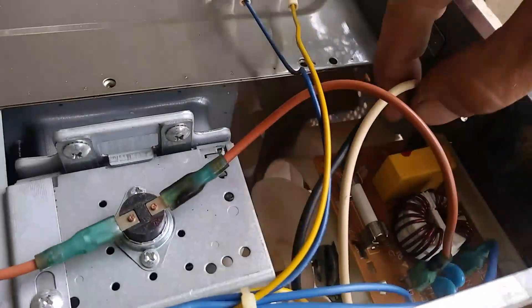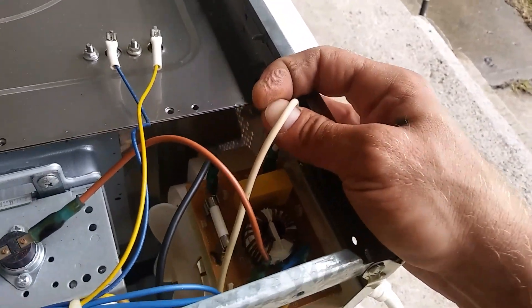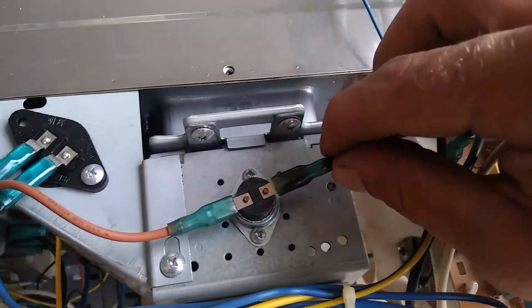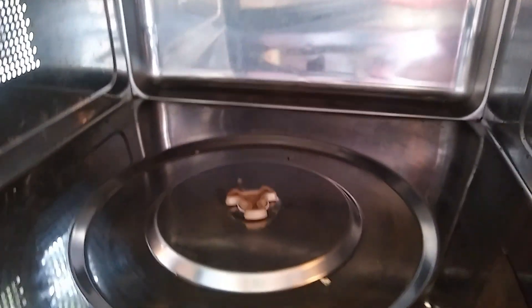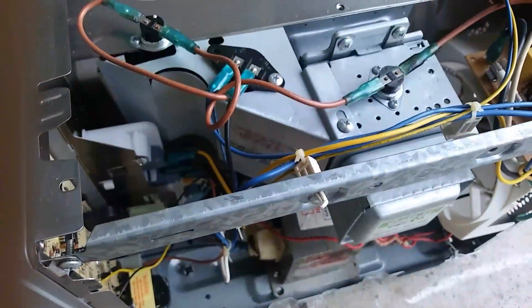When I tested it, I put my clamp meter on this wire and just had it open while I was running it — it was pulling about 13.2 amps while it was heating. So it's working now. I think I'll probably just replace that plug on there and put it all back together. It's just missing that round dish at the bottom, but I think I got a couple extras, so if not I'm able to find one somewhere. Thanks for watching.